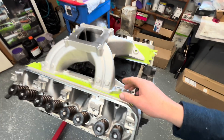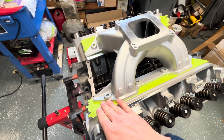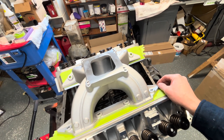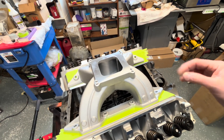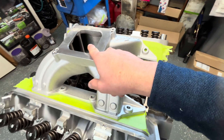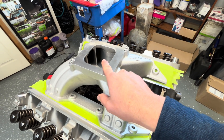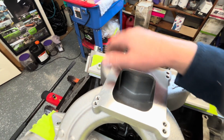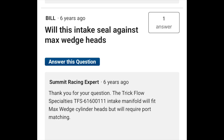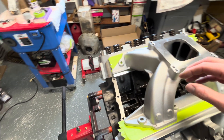I'm going to get our bolt holes lined up. There's no gasket on here — I'm just doing this as a size comparison, a quick reference. I would look down the port, but they are massively undersized on this intake. And Trick Flow does say you can trim this intake to fit those ports. I'd like to test that right now and just be sure, because it looked like a long way to me.